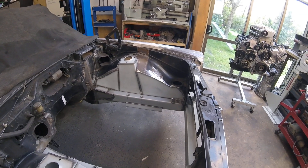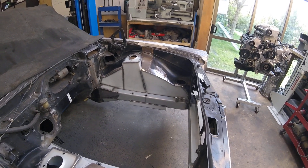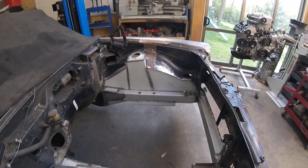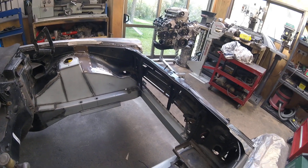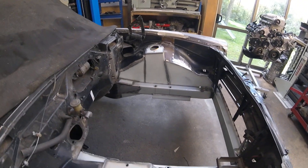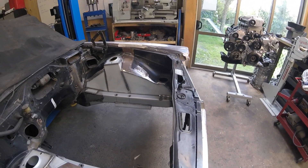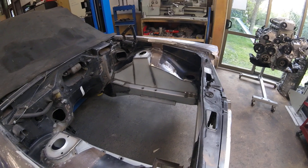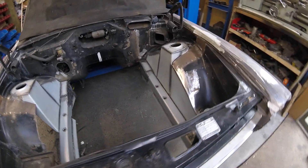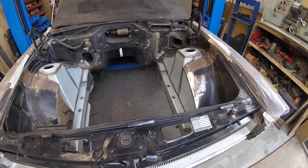You'll see down the bottom there's a little extension on the bottom of the chassis rail — a bit of a mounting plate. That was a cheat to drop the engine down about 30 millimeters. The chassis rails basically needed to be at that height to line up with the front cross member, which has the bumper in front of it. I could have designed it with the rails lower but that would have caused issues up at the front, so I left the rails at the same height and put that little extension on the bottom. That tapers towards the inside, which helps with the mounting position of the caster arm mounts and gives clearance for the engine.